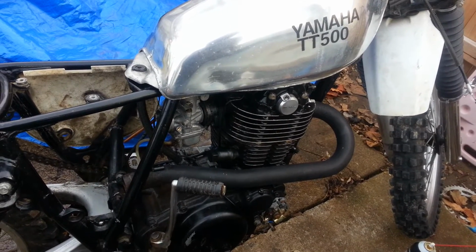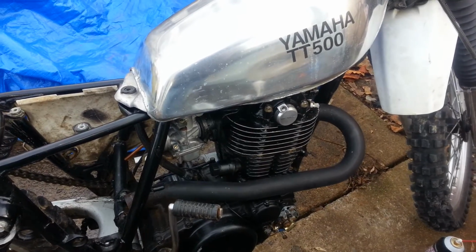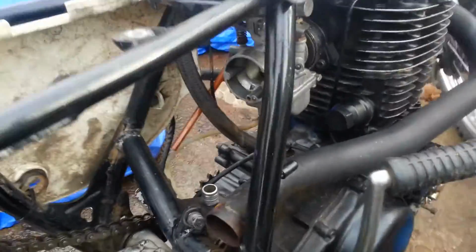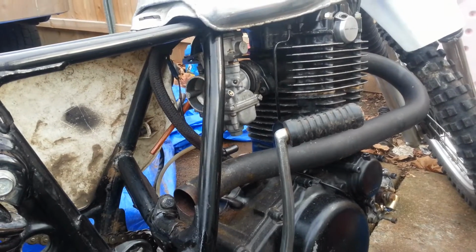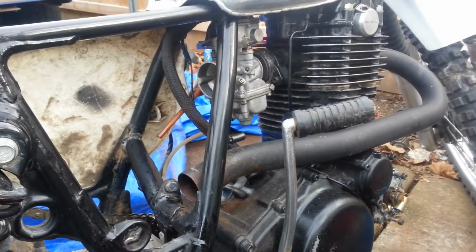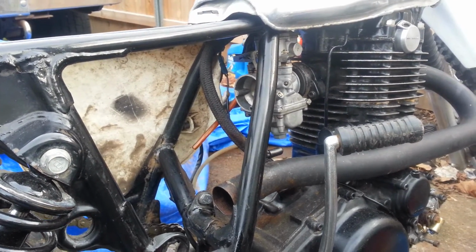Sounds decent. But I may have to take the engine back out and retard it a little bit more. I don't know. It's a little difficult being that the cam was not matched with the clockable cam gear. So that makes it a little bit difficult to get the timing exactly right. But I think I got it. I think I got it. The engine sounds normal again.